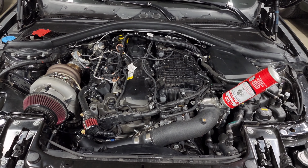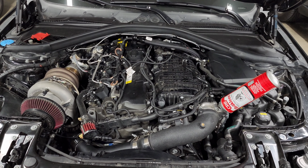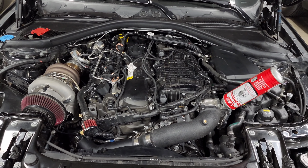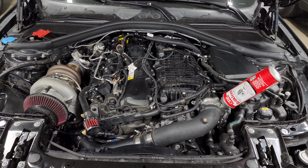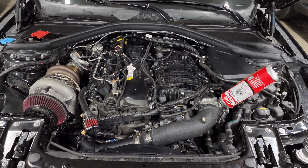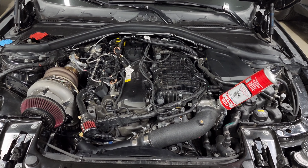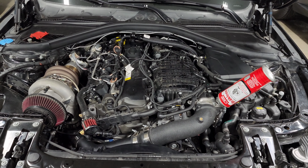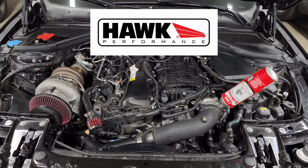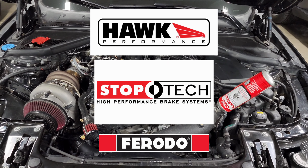If you get racing pads, they can run really high friction materials that will eat through rotors. They'll squeal really badly when they're not up to temperature and they'll make a whole lot of dust. But they do also make street performance pads that will be just a little bit better than stock without having to sacrifice so many other things. So check out companies like Hawk, StopTech, or Ferodo, and they all make different options that work for our cars